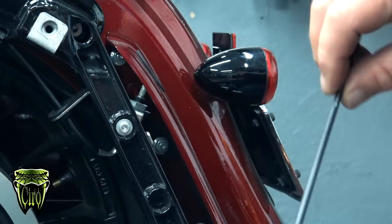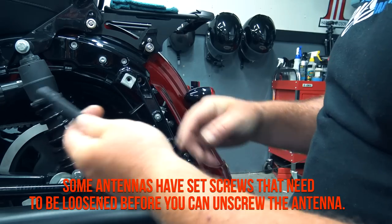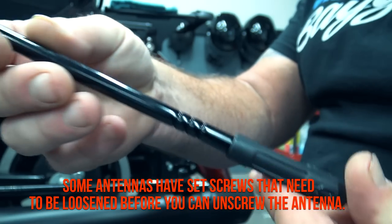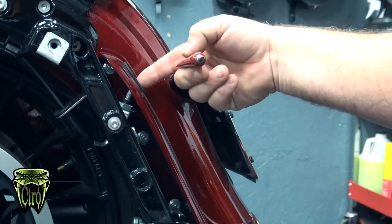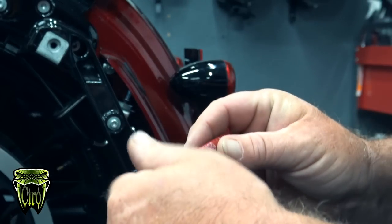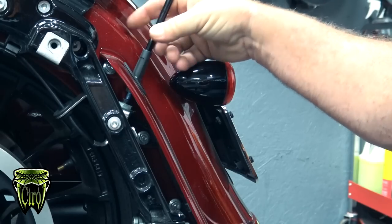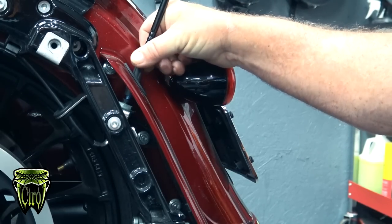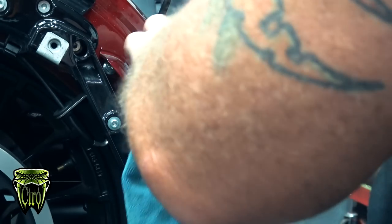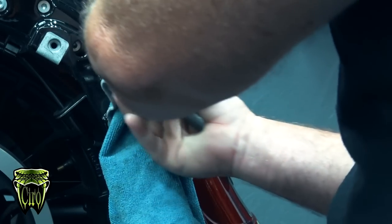See, it's just a standard antenna. Instructions as always from Ciro. This is the black one — you can also get it in chrome. It does have a flexible rubber base, and it's got almost like a bullet end on it — that's probably why they call it the High Caliber. We're going to go back through the hole, add a little bit of blue loctite to the base, put this one in, and then to tighten it I'm going to take a towel, put it around the antenna, and use my channel locks really close to the base and give it a twist to make sure it's good and tight.